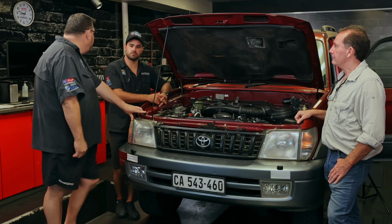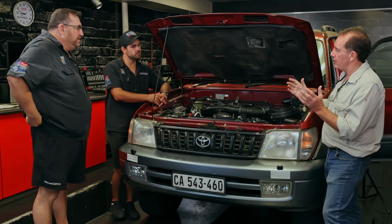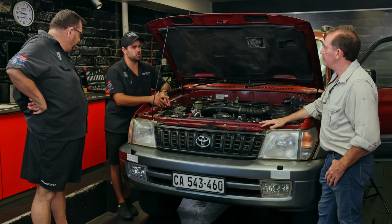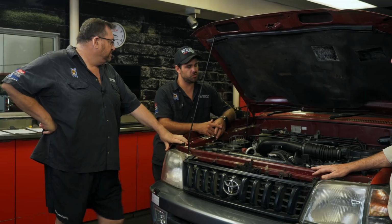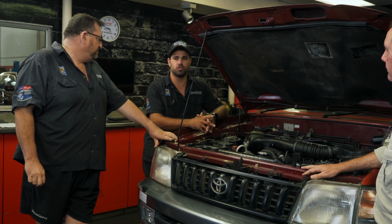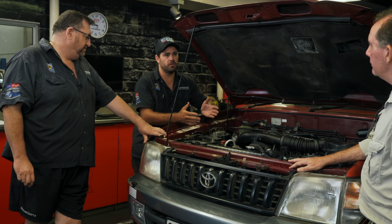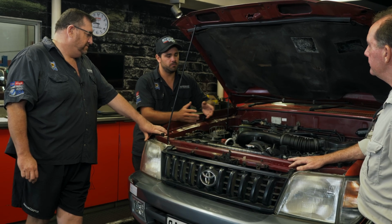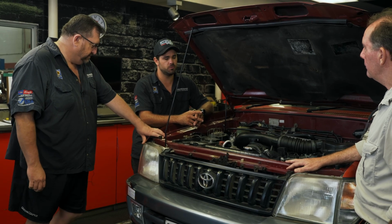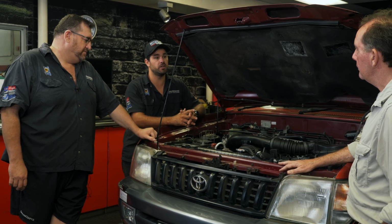You want to tell us a little bit about how you would go about getting the ultimate tune? When would you do that, Mark? After what sort of mileage would you want to see a car back? Well, basically, in a case like this where it's a brand new motor, as soon as it's run in and it's got its oil change after the run-in oil, I'd say it's good to go for a tune-up. I mean, if anything would go wrong, it could go wrong in your run-in time. So after that, I'm definitely happy to optimize and do some tuning and up the power and see what we can get out of it. Obviously, doing it in a safe manner.